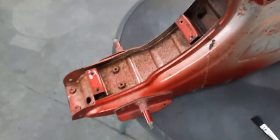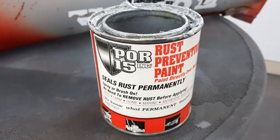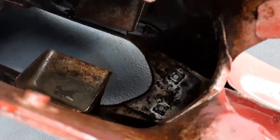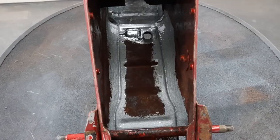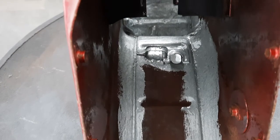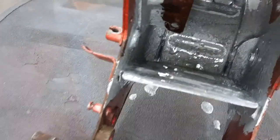I'm taking a two-stage attack at this rust. The first thing I'm doing is hitting it with Loctite rust neutralizer - any of those sprays will do. I'm hitting this light rust with the spray and doing the two coats it calls for. Then I'll use this pour product - it's awesome for really rusted-out parts. Inside with the light rust I'll just hit it with the spray. The pour I've got in the cracks - it's going to seal and work kind of like a body seam sealer and stop the rust completely.